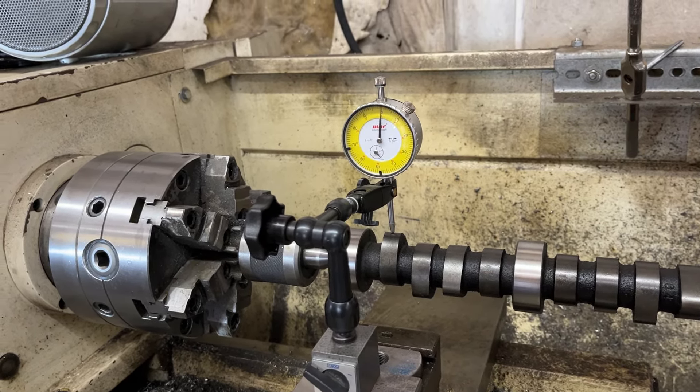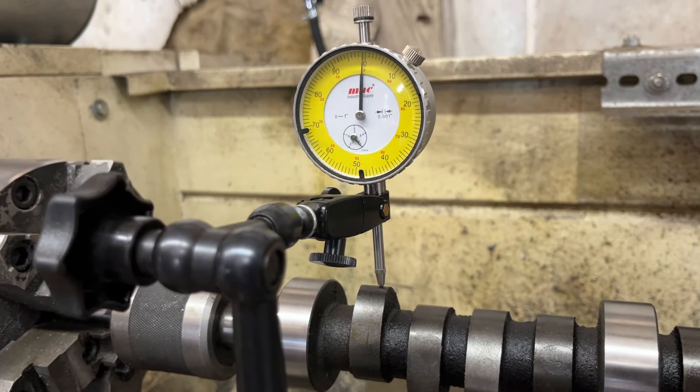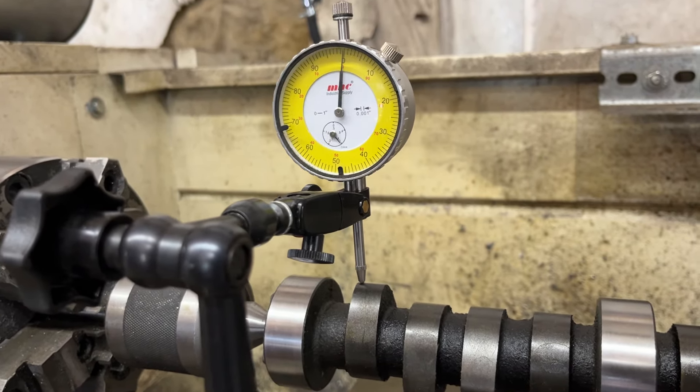Watch this. We're going back and forth across the top of the camshaft lobe, and there is virtually one-tenth of one-thousandth change in the height of the camshaft lobe. That should be two to three thousandths. When you do this, that results in your camshaft being basically flat and your lifter being unable to rotate, and that's one of the reasons it's causing so many camshaft and lifter failures.